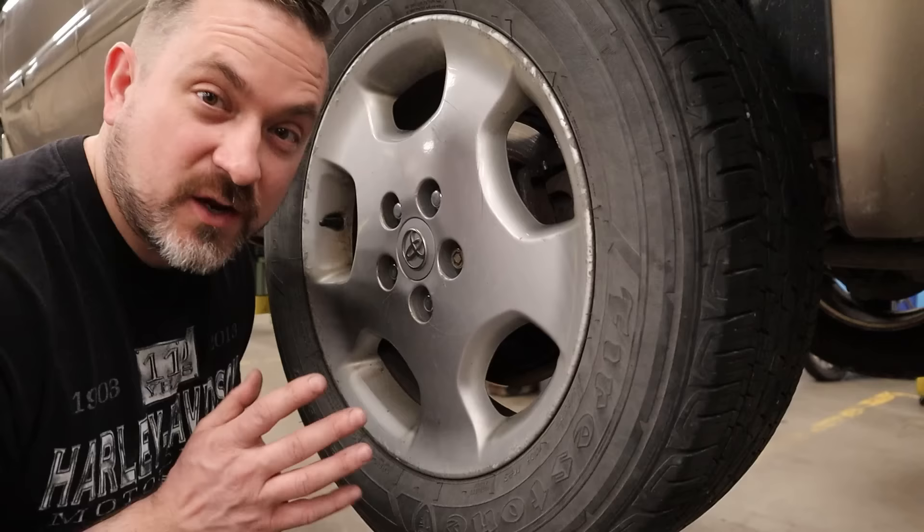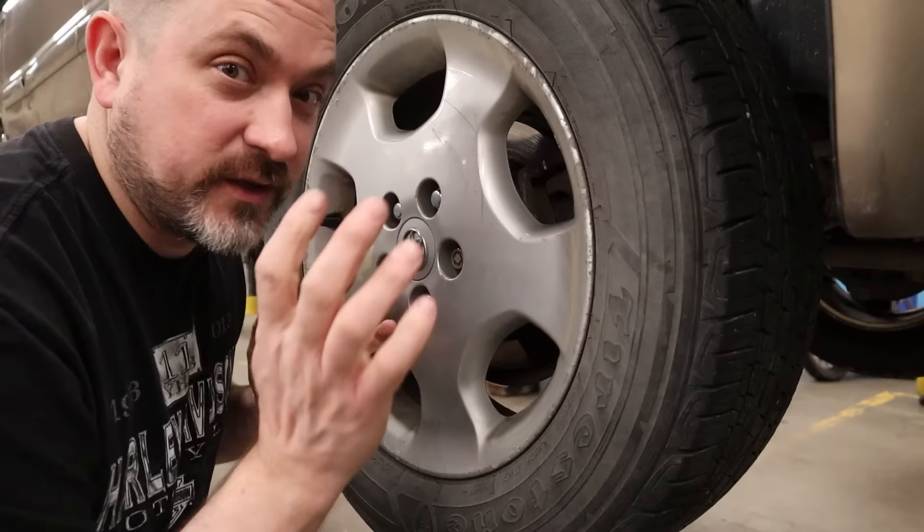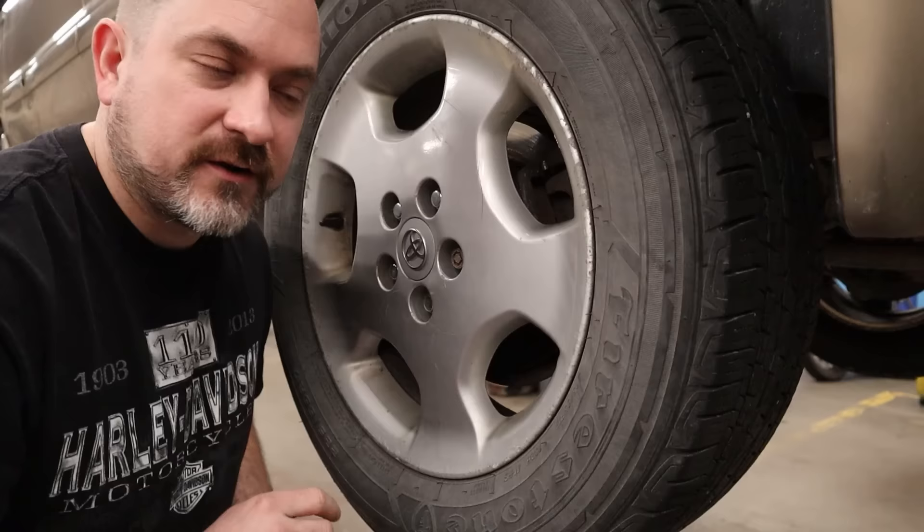I'm going to change the position of the camera so you can actually see the play, because this one is bad and needs to be replaced. I'll show you a good one after so you can compare the two. When checking wheel bearings, no play is what you're shooting for. However, there are various degrees of how badly worn out the bearing can be — when it's really obvious it's quite dangerous with a ton of play, and when it's just starting to have issues the play is a little more minor. I'll shake it and crank up the audio in editing so you can actually hear the clunking.